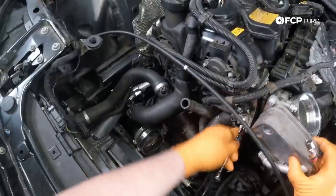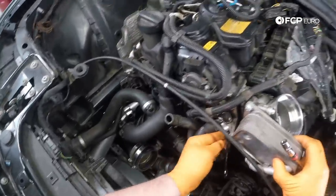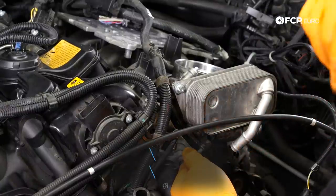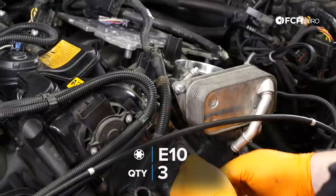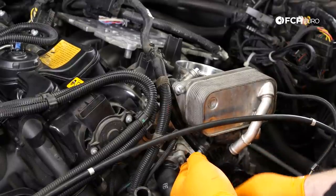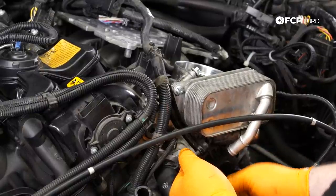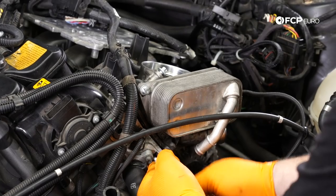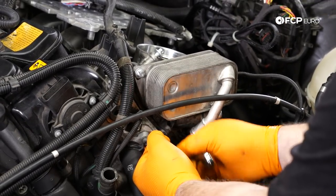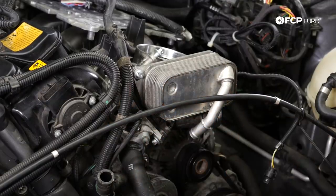to the point where you can then pull the oil filter housing mostly flush with this bolt, and then you can do the other ones. Reason for that is, like I said, this flange is in the way. Even though this has a metal flange on it, normally you'd have a plastic flange on this hose at the cylinder head, and those plastic flanges are known to break. So if you can avoid removing that just in general as a practice, that's going to be kind of preferable. So that one's bottomed out there.